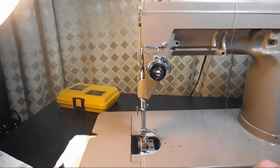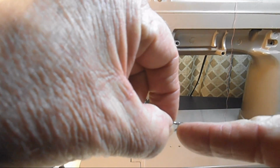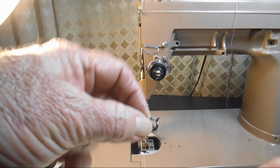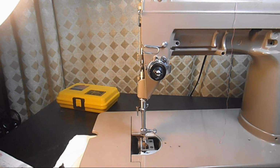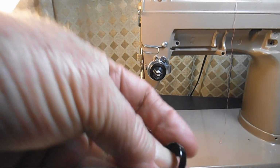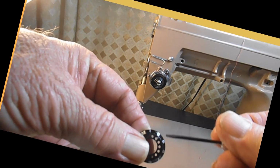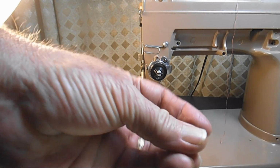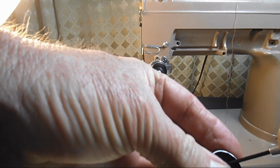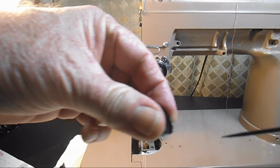Okay. Then the stop spring, and the little crooked finger, I call it, or the post. There's a technical name I don't remember, but the tip of it should point towards you. And what that does, here's my tension screwdriver. On the inside of the dial, right at or next to the number 0, behind the 0, on the inside of the dial, behind the 0, there's a little post in there. I think you'll be able to see it,